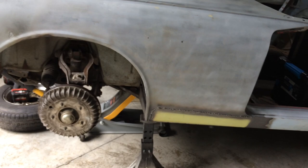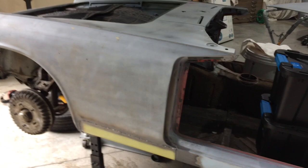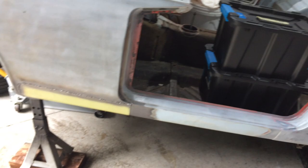That took a lot longer than I thought — all day just to put that patch on and do the stuff under there. Next stage is grind all that off, dress it up, and there's a few dents here and there that need fixing — basically I'll just give the whole thing a skim coat of bog. This top section's done. Anyway, the door's got to go on, make sure it all lines up. I'm pretty happy with it — it's turned out good. Thanks for that.